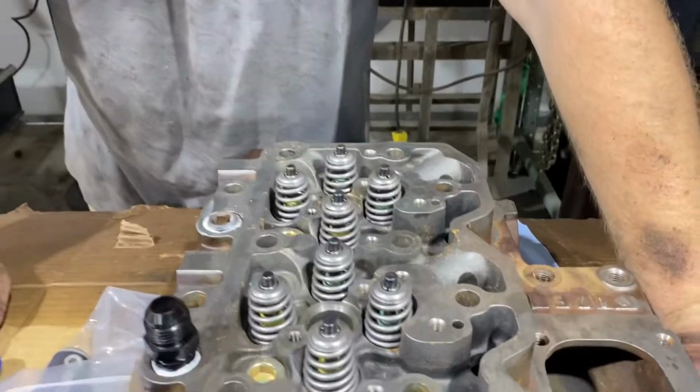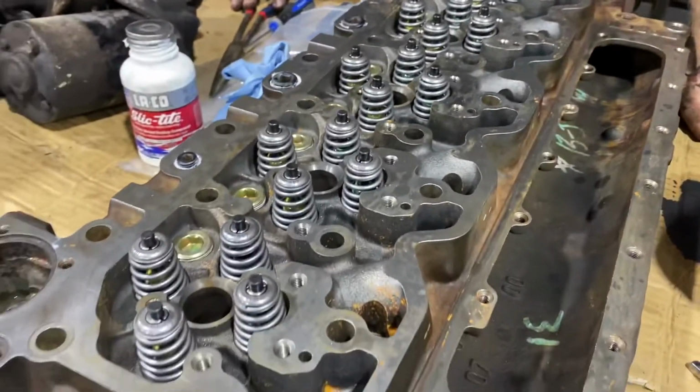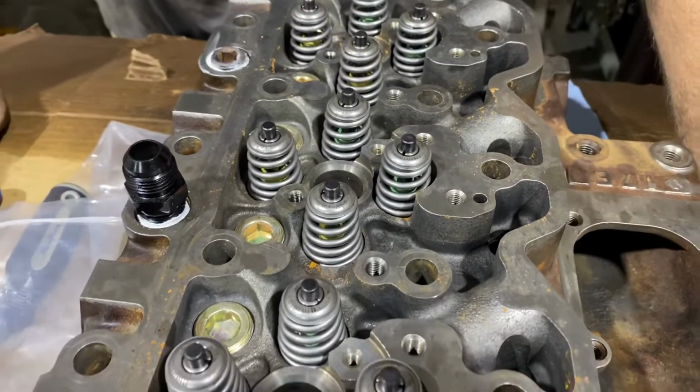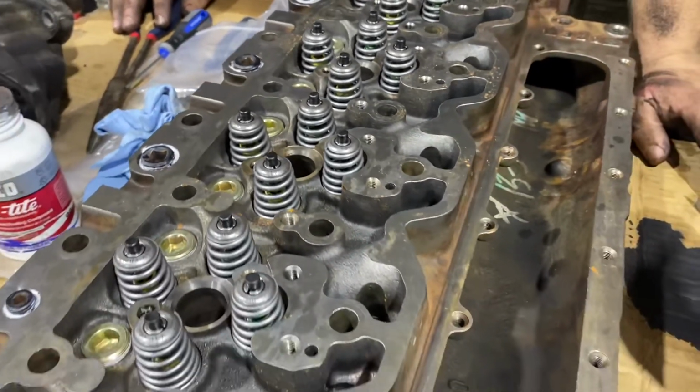Back in the shop with the hero of the day. RMS Titanic at it again. What'd you do while I was gone? I put the head back together. Thread in freeze plugs, lap the valves in, put in the new upgraded valves from KDD, new springs, retainers, everything. So the head's ready to go back on? Almost. Yep.